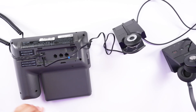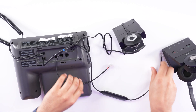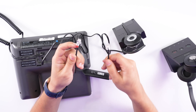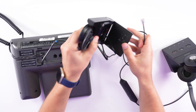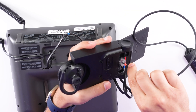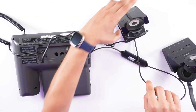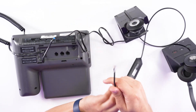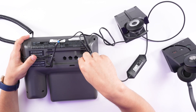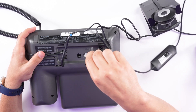Once that's plugged in, go ahead and take the Link 43 cable. As you can see, there are two different sizes of clips. You want to take the one with the red symbol and plug it into the back of your Jabra charging base — there's only one spot it can plug into. Once connected, take the other end and plug it into the aux port of the phone. There are a number of spots you could plug this cable into, so make sure it goes into the aux port.